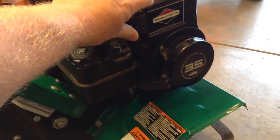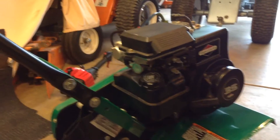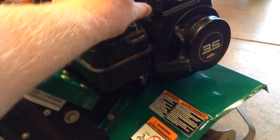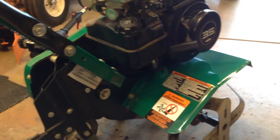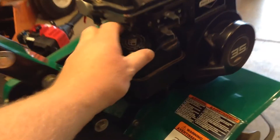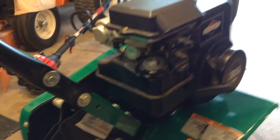It runs really really good. Before it was jumpy and chopping and everything else. I just got everything done — a new spark plug in it, pretty much that's all I did. The air cleaner is like brand new. He filled it up with gas before I got it, so I just dumped some Sea Foam in there, run this tank through, clean this thing up a little bit. I thought maybe at first it would need a diaphragm or something, but it's running a lot better than when I first got it.